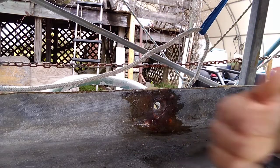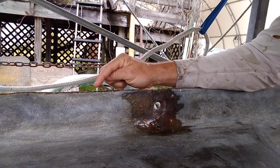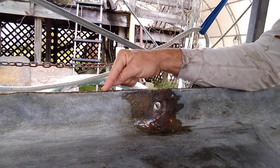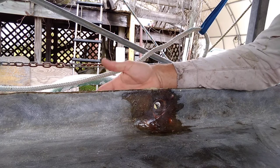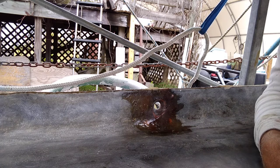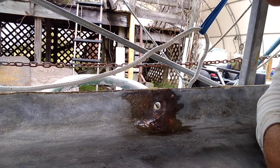That piece will wrap all the way around and down the other side to the same spot, so there's one single piece covering the edges. The reason for that is not so much for strength — it's because if you try to put resin on these very thin edges it goes on very thin, and if you then sand it you'll sand through it and you won't realize it until it's been sitting for a week or two and you start to see rust spots.